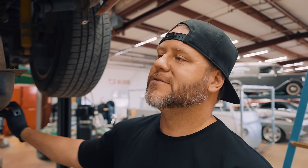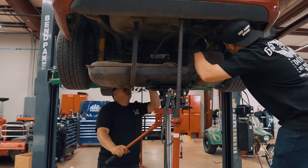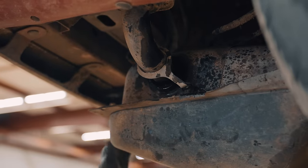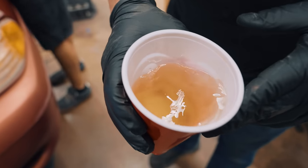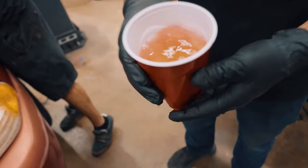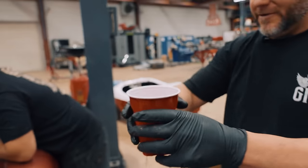We're putting our fuel tank back up — that's going to be our last step before giving it a test run. Then we'll test fire and we'll have to set the timing. That was a very important step — we primed the fuel system with the fuel hose unhooked from the Sniper. You can see how cloudy it is — there's a lot of dirt in there. We did not need that going into the Sniper, which has injectors we do not want getting dirty. There's proof — now the cup is deteriorating, I've got to go.